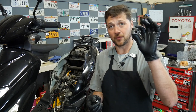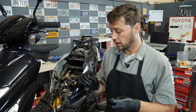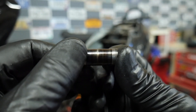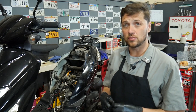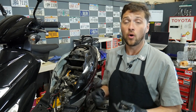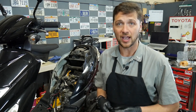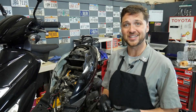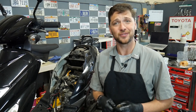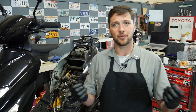As we were removing the wrist pin from the piston, it was extremely difficult. Upon closer inspection, we noticed the wrist pin has a bad gouge through the center of it, and that corresponds with a gouge in the small end of the connecting rod. Whether that was due to poor quality casting, a manufacturer defect, or the bike being run without oil, we don't really know. But that wrist pin is not something I would trust throwing a new top end on, so this is going to need an entire new motor. We could split the cases or replace the connecting rod, but at that point we're just in it way too much labor. This should end with a reminder to check your oil and change it regularly. If you like this video, please give it a thumbs up and subscribe to the channel.